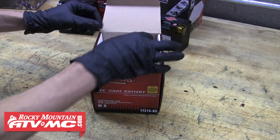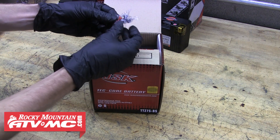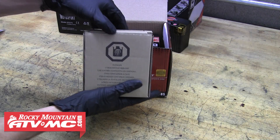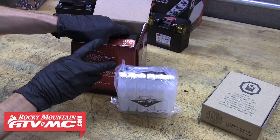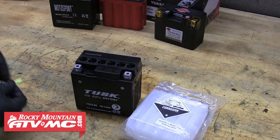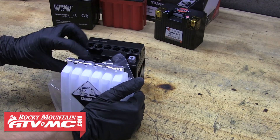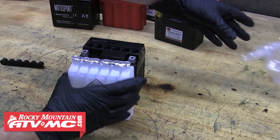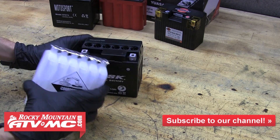Before we discuss charging methods, we're going to demonstrate the proper way to fill a maintenance-free battery. After opening the box, you'll find the instructions along with the battery hardware, and inside a small bag you'll find a little push pin — we'll talk about what this is for shortly. Pull out the acid pack, which is a pre-measured individual cell pack specific to this battery. The first step is to remove the foil cap that sealed the battery. Then remove the acid pack from its plastic packaging — you'll notice there's a plastic cap on the acid pack; set that aside as it will become the cap for the battery. Each cell in the acid pack is sealed by a foil piece, and each cell on the battery has a sharpened edge designed to puncture these caps as the acid pack is pressed down onto the battery.